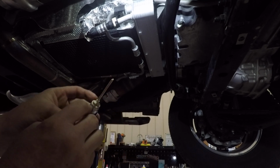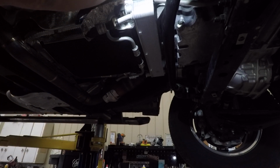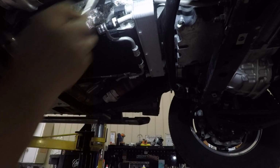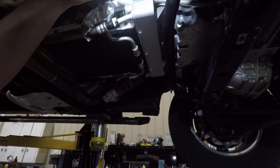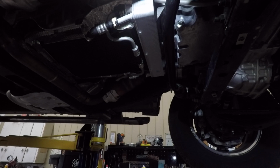And it's got a little gasket here. So that's how you check your fluid. And of course, to fill it up, you've got to have a pump that you can buy at O'Reilly's or anywhere, that you could pump your fluid up into that hole and keep checking it at operating temperature until it gets to the right amount, which on the 6-speed transmission seems like it was around 7 quarts or so.